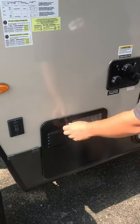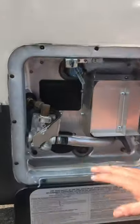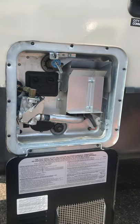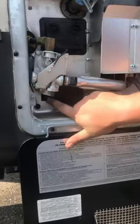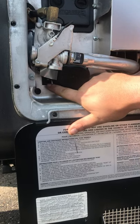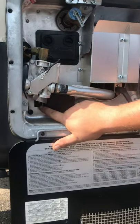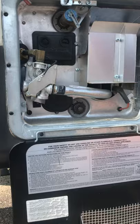The water heater here is a six-gallon propane or electric water heater. Propane is auto-ignition, controlled on your control panel inside, as well as the electric element. There's a switch here for the electric — there's an on/off switch here and also one on the control panel. Both must be turned on for it to work on electric. You are able to run both electric and propane at the same time for the fastest recovery.